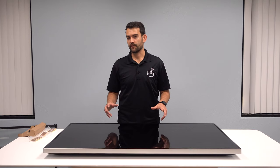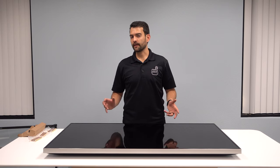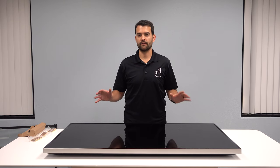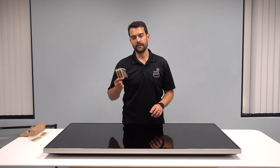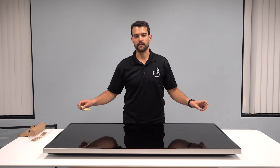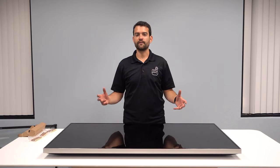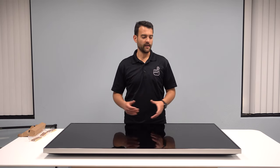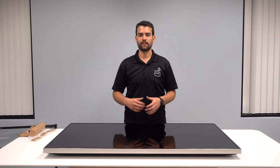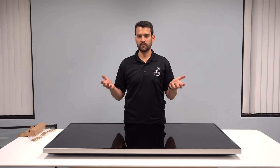When you're choosing your television, there are a couple guidelines we suggest following in terms of the bezel width all the way around the edges. Our recommendation is at least a quarter inch wide and completely flat and glossy smooth. That's to ensure that the double-sided foam tape you're going to use to attach the glass and frame layer to the television adheres properly and won't fall off and cause damage. This Vizio 55-inch, which we use in our showroom, is a perfect model as it has a quarter-inch bezel, perfectly flat and smooth all the way around — not curved like some Samsung series where the tape won't have an even flat area to adhere to.